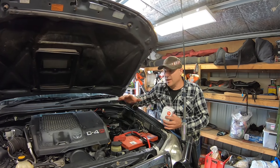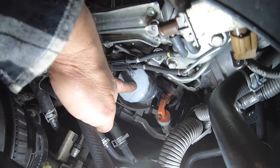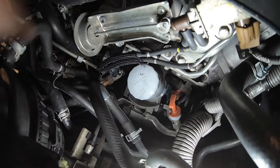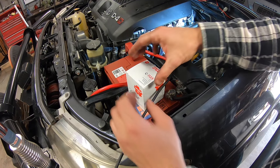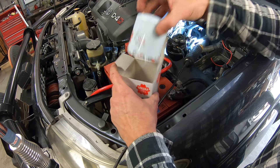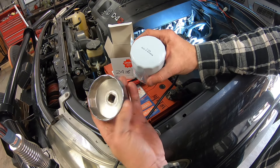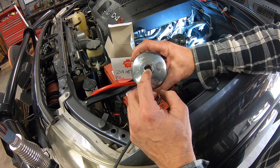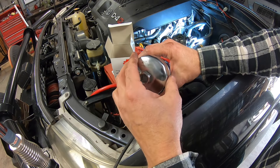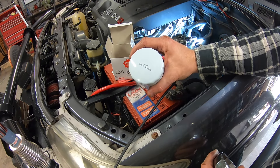While that oil's draining, we come back up to the top half of the engine and I'm going to replace the oil filter. The oil filter for this vehicle is situated right here — you can simply just unscrew it. Sometimes you can get them by hand, but I've always found it's a bit hard, so I've got a special tool. The new oil filter has these ridges on it, and it's like a huge socket. I clip it straight on, give it a tap, and a couple of extension bars give me enough room to twist it off without breaking my hand. That's how I take the oil filter off on this vehicle.